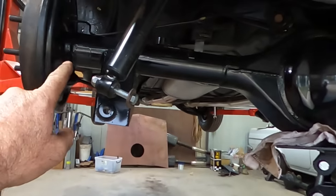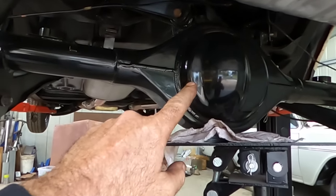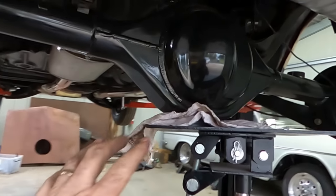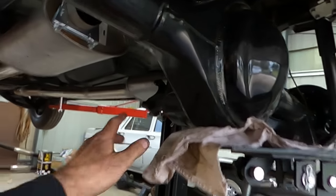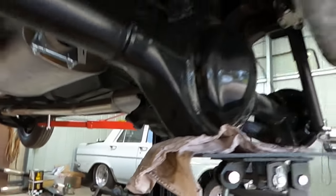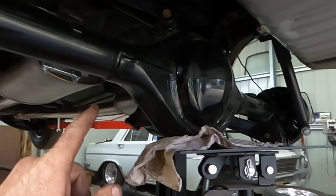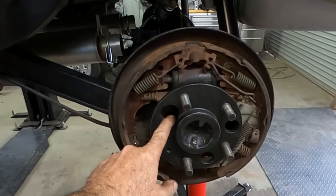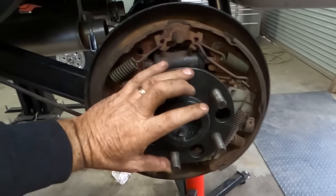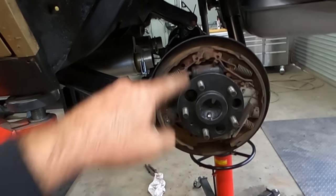And so I'd say that axle is now pushed so far in that it's actually touching the pin, because don't get me wrong, with a rebuilt center and brand new bearings, there's going to be resistance. You're not going to spin it over like there's no resistance at all. And I checked that when I put that one in, it still spun over. This one was spinning okay until my last two turns of these bolts, and now, without really trying to force it, it's way too tight. So there's something going on.